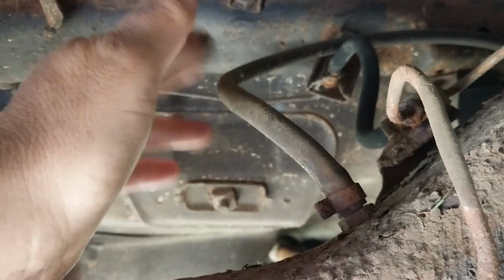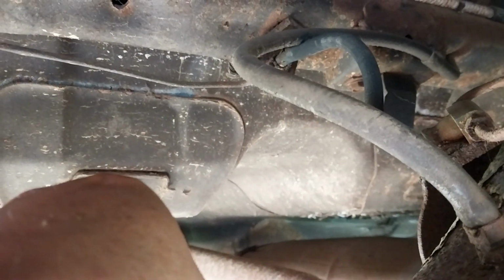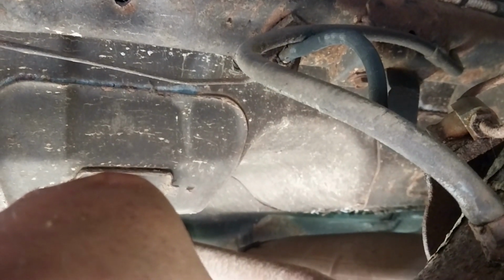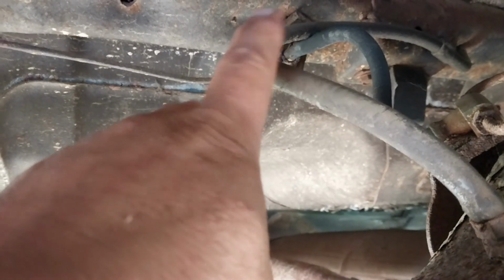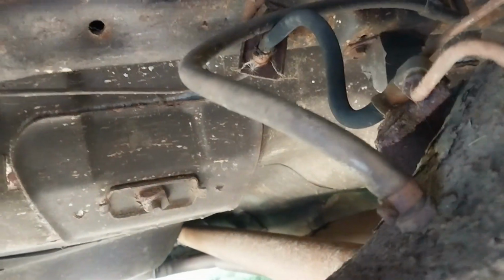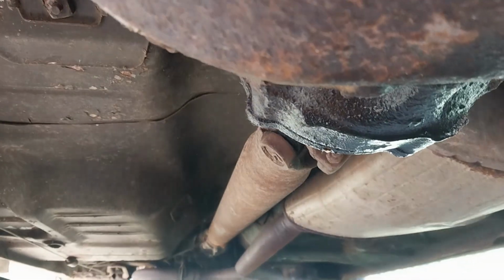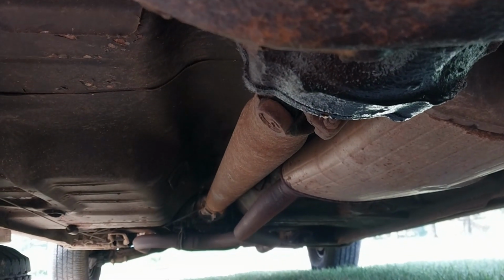Mud daubers like to get into the end of this tube, which is supposed to be hiding in the frame somewhere, and it's going to the other side. You can kind of see where the things are going. We just got to make sure this is open and clear, and I suspect that it's not. And that'll cause sweating. It'll actually cause pressure to build up, and it'll shove it out the pinion seals. So we'll pause you and get to work in here.